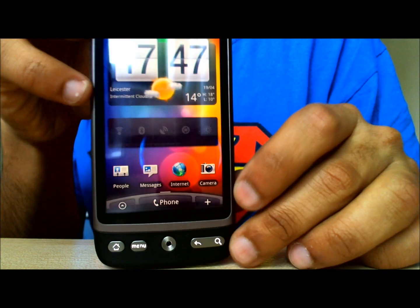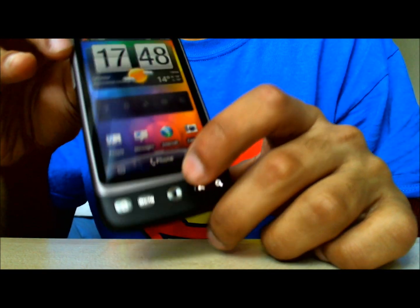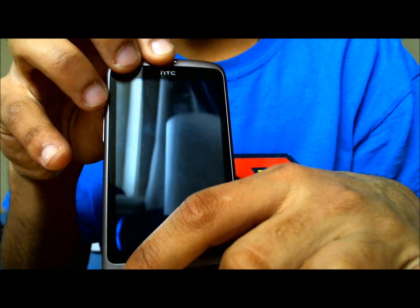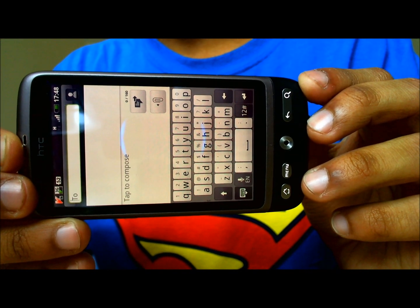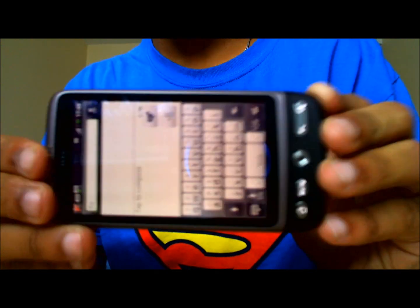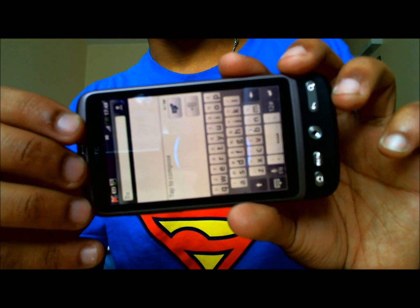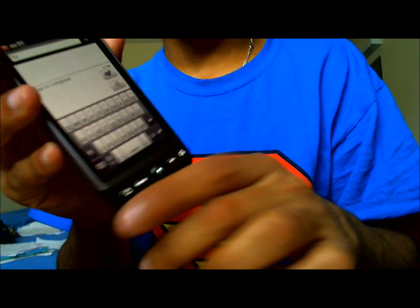Keeping that auto-rotate function on, if you go into Internet Explorer — for example, Facebook — it does not auto-rotate by itself, as you can see. This is because the calibration has been done wrong. If I go into messages and tap to compose, it does not turn sideways. If you calibrate it properly it will go sideways and auto-rotate. Sometimes when you calibrate it wrong, it automatically rotates 90 degrees so that it's horizontal and it doesn't want to turn back to vertical. That's because calibration has been done wrong.